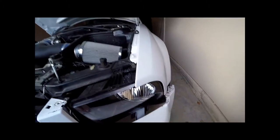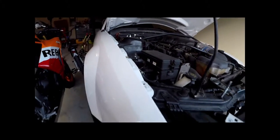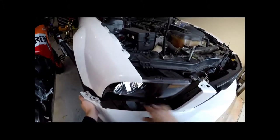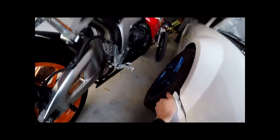When you put the bumper back on, make sure you put those little tabs that are up under the headlight into the slot they go into. If you miss that slot, your bumper looks droopy under the headlights. It has two little tabs on top that help you pop it on, which makes it look and fit really good.